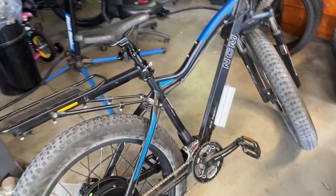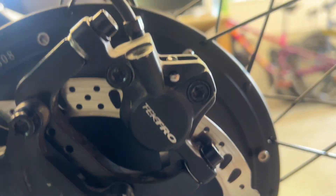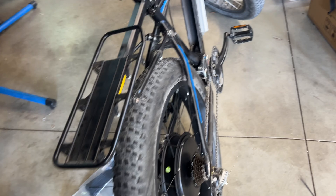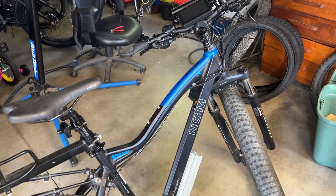Here it is ready to ride, just need the battery in it. One thing over here — this brake caliper had to be spaced out a little bit with some washers, because this axle has a bigger diameter than the original axle. So it sets the wheel further away from the brake caliper and had to be adjusted a little bit. We'll take it for a ride and let you know how it is.